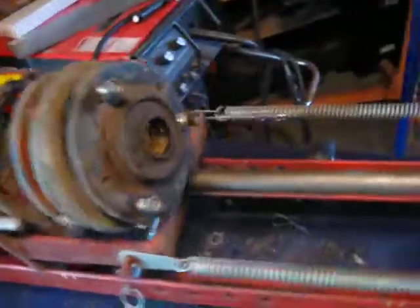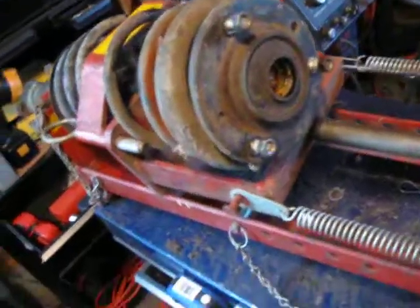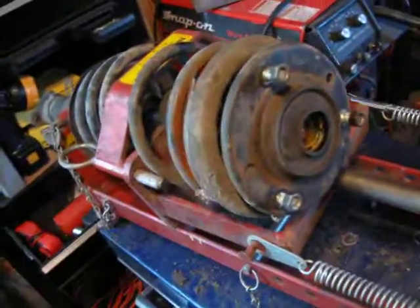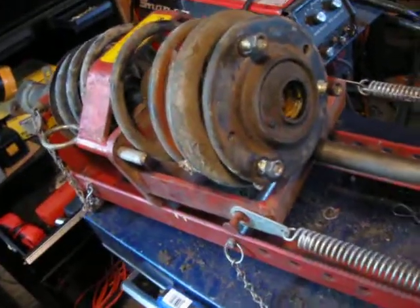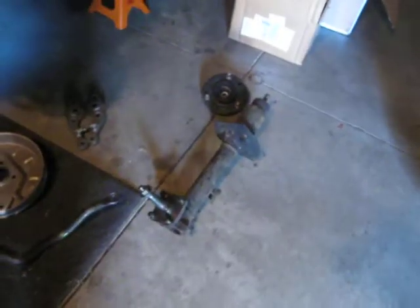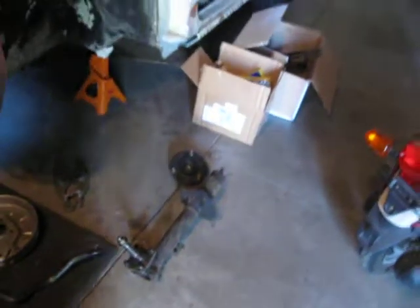The air pressure holds it really tightly, and now all I got to do is take that nut off and break apart the whole thing, and once I have the hats off, then I can slowly release the pressure, and then the spring just pulls out. And you can see I've already got one there, and the other strut down over there. And beautiful sandblasted parts there, which is what these are going to be later, because they are filthy right now. So that's all. Bye-bye.